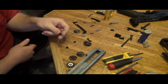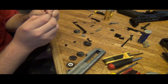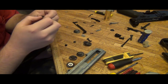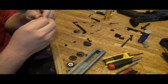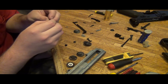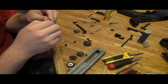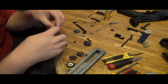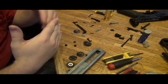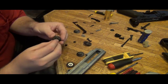And I can confirm that this kind of damage was too low. You know, there's a good reason why. It's because also there's nothing damaged at the front. At first I was assuming this was too tight, but you got to take a closer look sometimes and compare, and that's what I just did. Let's take a closer look and compare. Now this is at the back only, meaning that the bevel gear is just too far away from the pinion.